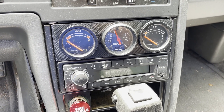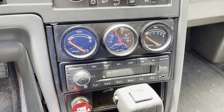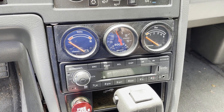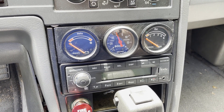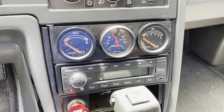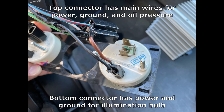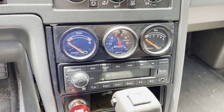Here is my setup. I've got all three gauges installed — the voltmeter is working and the turbo boost gauge is working. I installed the oil pressure gauge but it didn't get fully installed at the time. The gauge does have power and is connected to ground. I did take a picture of the back of that gauge so you can see the connections. Ahead of time I ran a long yellow wire for the connection to the oil pressure sensor and tucked that up behind the dash, knowing I'd use it later.